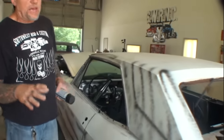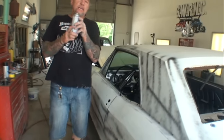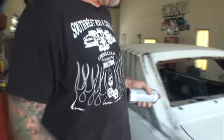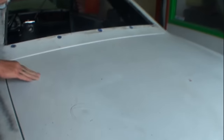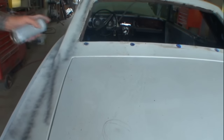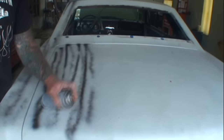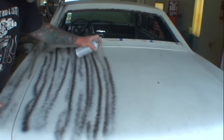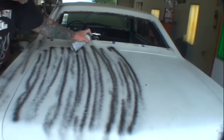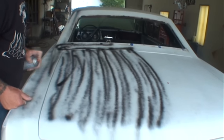As you can see, this car is pretty dirty. We're going to leave the dirt on there and go ahead and put a nice thick guide coat on this deck lid. This is how you want to apply it — just nice and quick, covering every surface. We're not going to paint the whole car using a spray can — even though it's been done. Instead of using the DA for this section, I'm going to use a nice flat block — this block is designed for DA paper and has just the right angle for a piece of DA sandpaper on it.